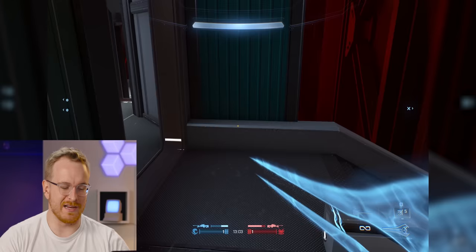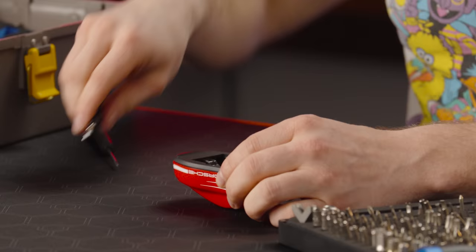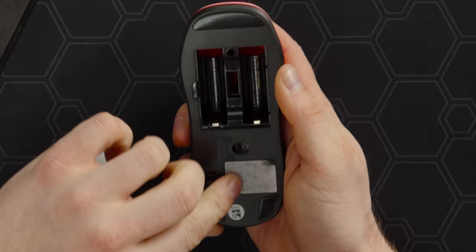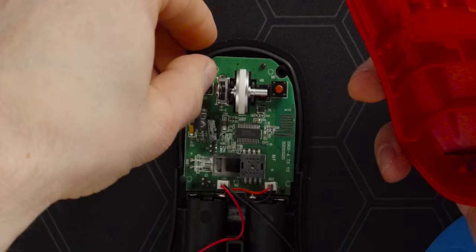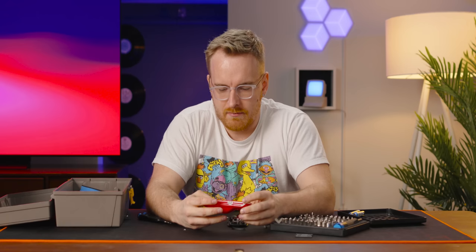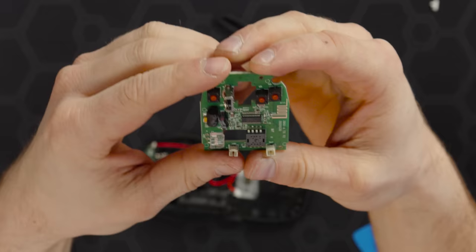Let's open it up and see if we can see why. The mouse doesn't look super hard to pull apart — there's only one visible screw. It was designed to go together very cheaply. There's probably another one under the manufacturer label. I really don't want to take the glide pads off, but it seems like I'm going to have to. These are actually switches — it felt very much like rubber, but it has little switches, so yay. The mouse is pretty easy to disassemble. There's a little daughter board, I'm guessing just for the LEDs, and the main board is here with the sensor. It looks like it's not impossible to replace.